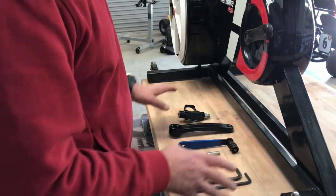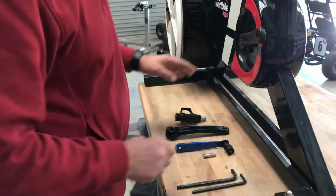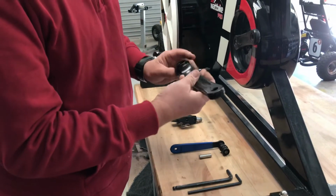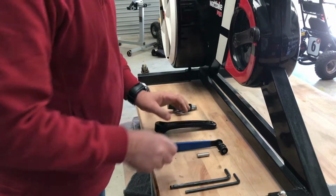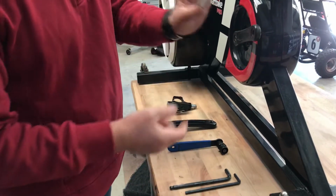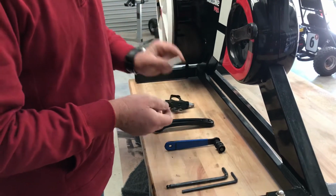I just wanted to show you quickly how to change the crank that's got the threaded sleeve in it. Obviously I'm going to send you this, which is the replacement left-hand crank. I'm also going to send you this little barrel. I've only got 2 of these. You'll see what this is for in a minute, but if you could return this, that would be great.